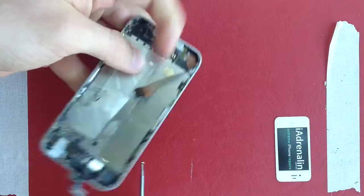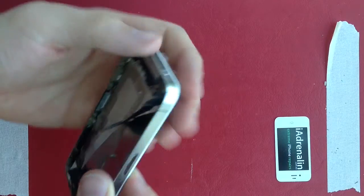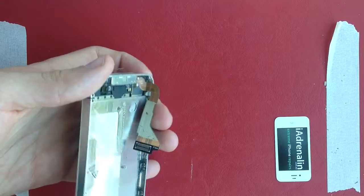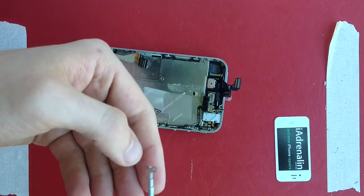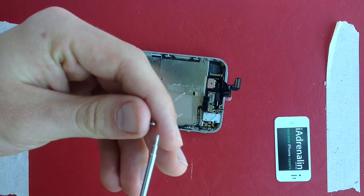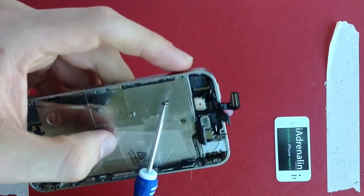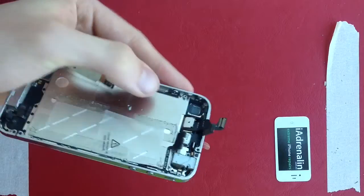If you're finding that the screw isn't going in, double-check that the screen is actually attached and down, because if it's raised slightly it may not hook in correctly. Also be gentle with the cable just here. The trick to putting these screws in is to get your washer and screw pair, place them together, get the screw onto the screwdriver, and angle it up so it's harder to fall off. Find your hole, insert it with it still angled up, and get a few twists so it's in.